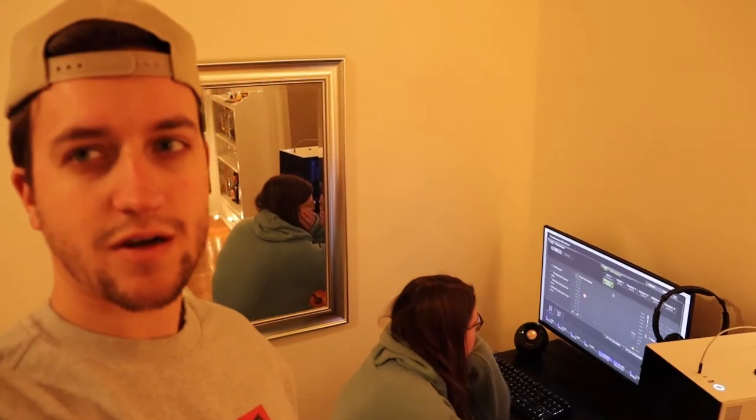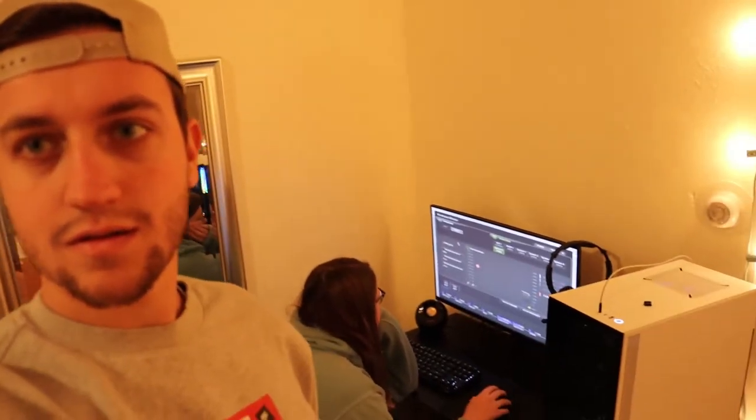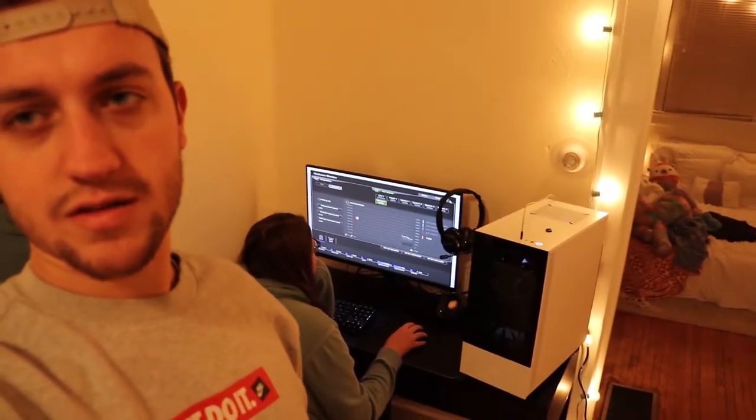So when I thought all hope was lost, looks like we did do it! For some reason these fans aren't working — it uses a weird fan central hub that I'm not familiar with, so I've been trying to look into this: the NZXT fan hub. It's this weird little thing that all the fans plug into, and it sits on the back plate of the case, then it plugs into the power supply, but I couldn't find anywhere that it plugged into the motherboard, so I think maybe that's what it's missing.